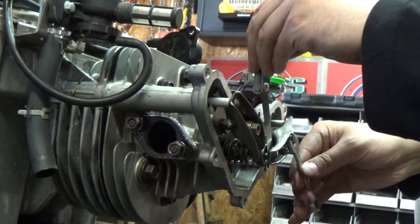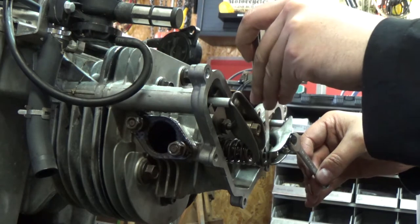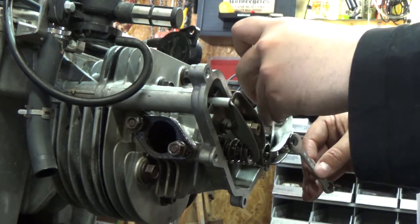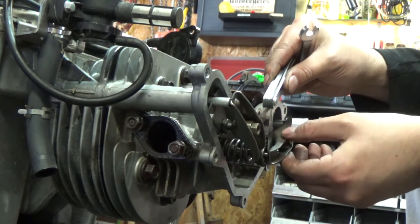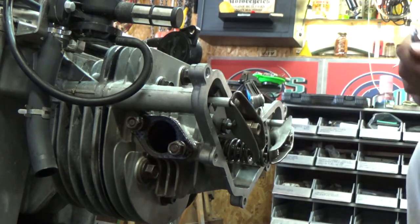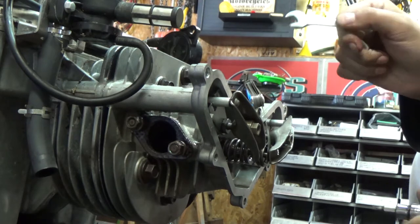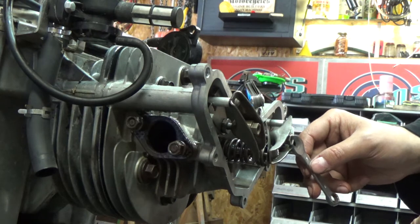But if I loosen this off just a little bit, watch how little I loosen this. Just like that. Okay, now it's too loose almost. See that? Now it's too loose. So what I'm gonna do is, it's really finicky, guys. You gotta get it almost exact. Just get it to the point where it feels just right. Right about there feels good. So now, again, I'm gonna leave my shim in place. I'm gonna get my T15 Torx here, set that to tighten. I'm gonna use my 10 mil stubby wrench here, and I'm going to hold that in place. Careful not to move it.